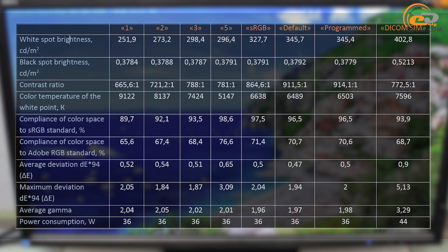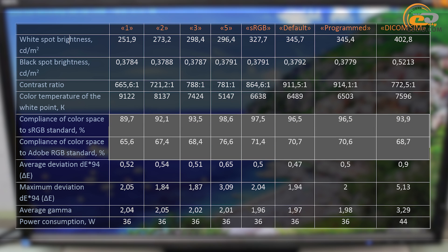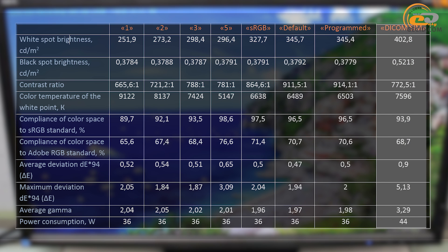The new product has 8 color profiles. In total, the default calibration is fairly good. The minimum brightness measured 251.9, while the maximum was 402.8 candelas per square meter — the typical claimed value is 350. The static contrast ratio did not reach the nominal value of 1000:1. Color rendition settings for Adobe RGB and sRGB color gamma are of a fair level, although nominally this monitor does not belong to the professional series. We should also draw attention to the DICOM SIM profile, which matches the medical standard and provides X-ray image viewing.